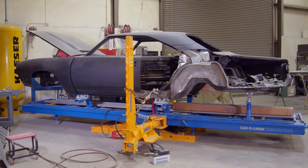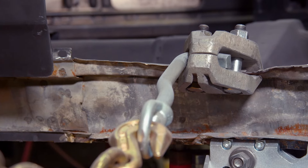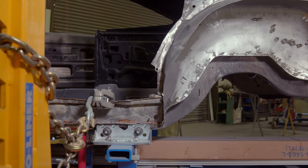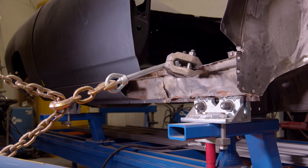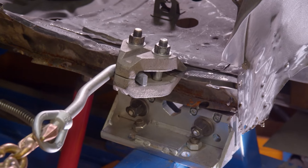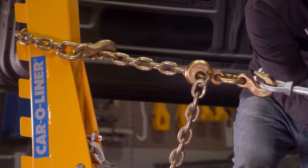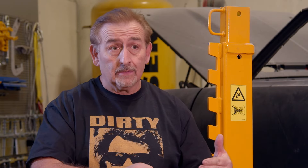On our 1970 GTX 4-barrel, we've already made pulls to the outer rocker and a section of the inner rocker; the inner structure for the quarter is also pulled and trimmed. This is the most crucial part — clamping right on to the floor where the floor meets the inner rocker and the under-seat pan and making a pull directly on that. We're trying to save the under-seat pan. Shane will make the pulls, and while it's under a load he'll do stress relieving — hammering the area until it's shaped right — so when he releases the pump it stays where it's at. Then we can start building out the inner structure and putting the car back together.